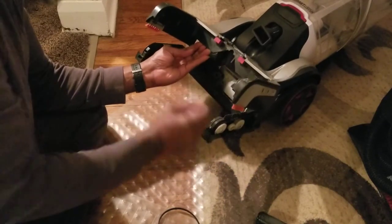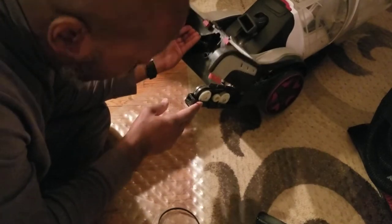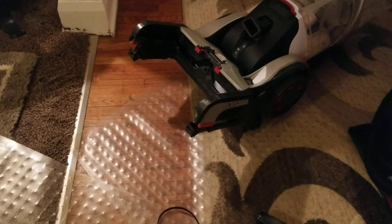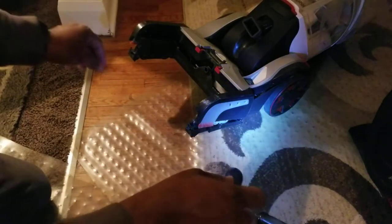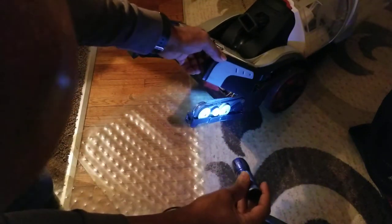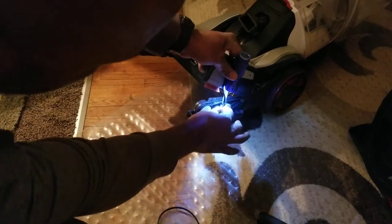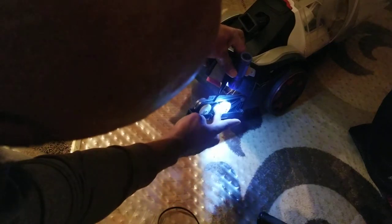It comes right up, and you'll see the belt over here — the belt is on this side. Let me get a flashlight to show you up close. When you pry off this top, you're going to see where the belt actually goes. This middle piece here has to come off — it just pops off, it doesn't need to be forced around, just slide it off. Then you put the belt on, and you pry or push this back on; it'll be a little snug.